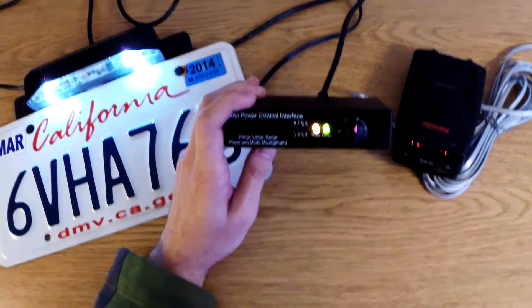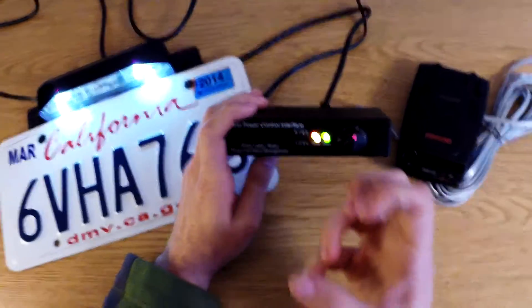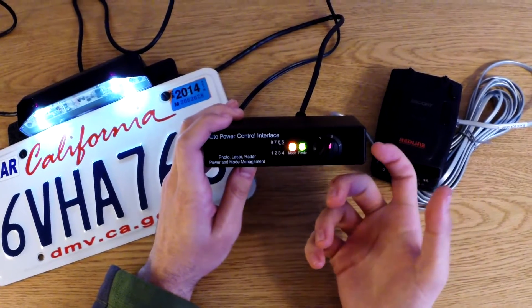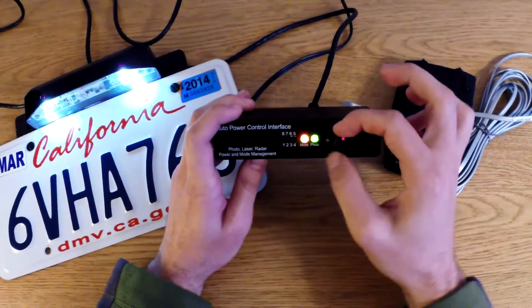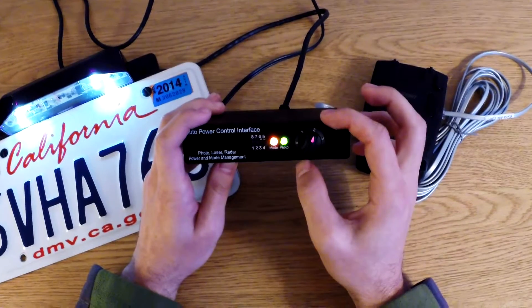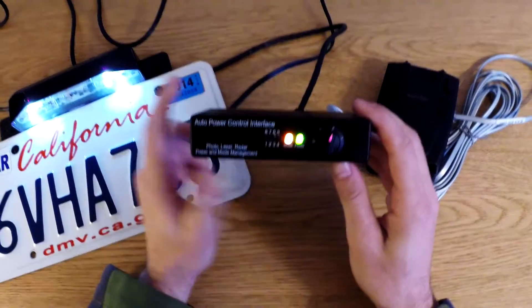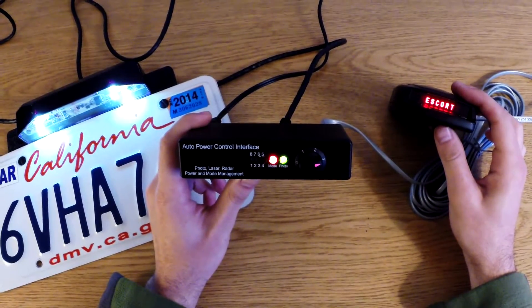Your jammers are going to have to restart. However, when I JTK, I really like leaving it in receive mode — the reason is it still receives, it'll tell you how long you're still being shot, and it'll still ID the gun you're being shot with. That's one thing I actually like about the 905s compared to the LIs, where you have to kill with the power switch. With this one, you JTK and you can still put it in receive mode and it kills the jammers instantly. This power-cut issue doesn't happen with the 905s but does happen with this. I've talked with Martin at ProDB and that is something they've addressed with their engineers — in future versions they're going to update this so it isn't an issue anymore.